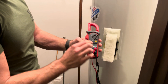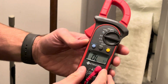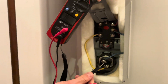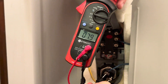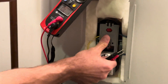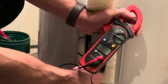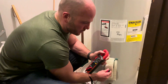To test an element you're going to be checking the ohms, which is the amount of resistance — the upside-down horseshoe symbol on the meter. You should get somewhere around 9 to 15 ohms of resistance on an element. You'll touch the screws on the back of the element — it doesn't matter which one is which. With the power off, your meter will start to register. This one's about 12.2 — that's perfect, so that element should be working fine. Do the same thing on the one on the bottom. 12.6 — that's perfect. So our elements should be working just fine.